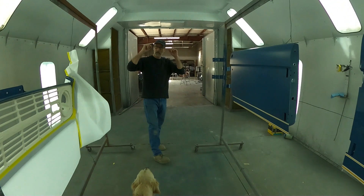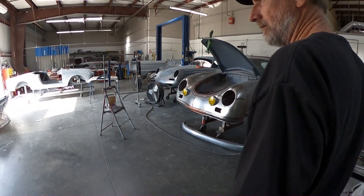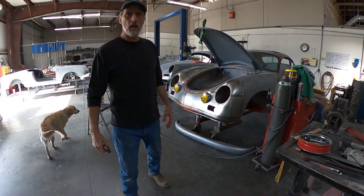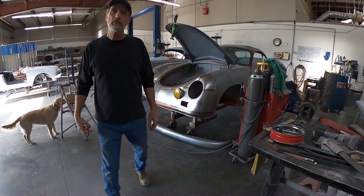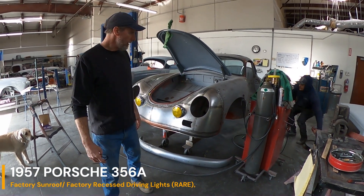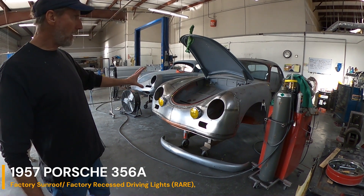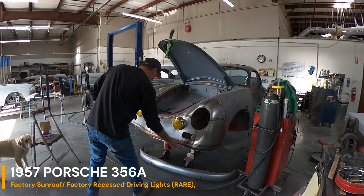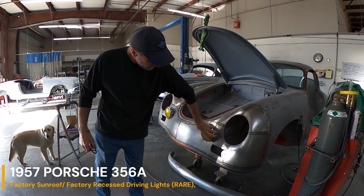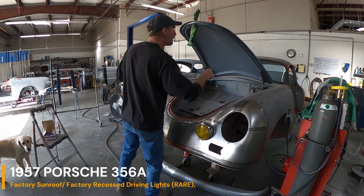I came over to show some people where Riley's at with the Porsches. Matt's welding up the rocker panel — left rocker on this 56/57 A-body. This was the rollover outlaw. Last time we talked the nose wasn't on it, but we got the nose and the rear body panel on, got the bumper holes so both bumpers line up nice, got the factory driving lights with the holes cut in and mounted where they need to go. Still locking stuff up, but all the welding is in and the gaps are good.